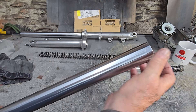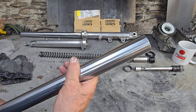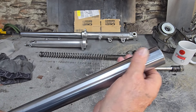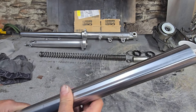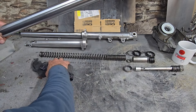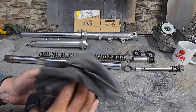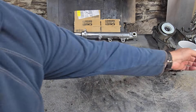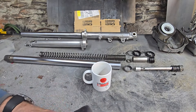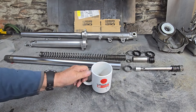There are ways around fitting the new seal - some people put a rubber glove around the stanchion with grease so the seal slides over cleanly, or you can use cling film, which is what I've done before. Anyway, I'm going to go and strip the other fork leg down. Thank you for watching - if you enjoyed the video please give it a thumbs up, subscribe below, and I'll see you in the next video.